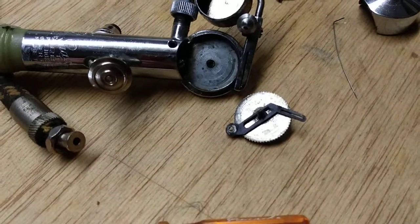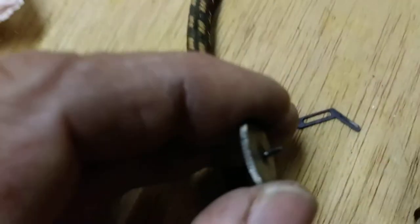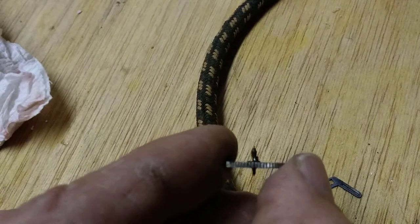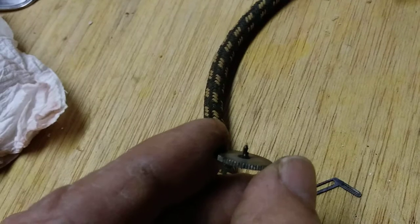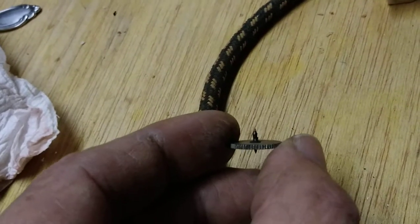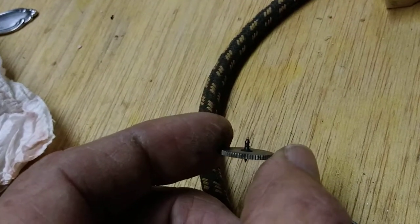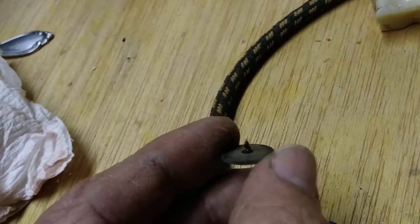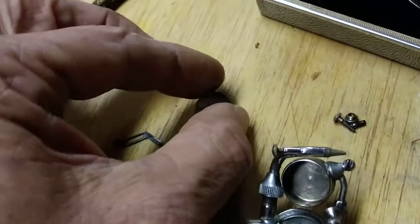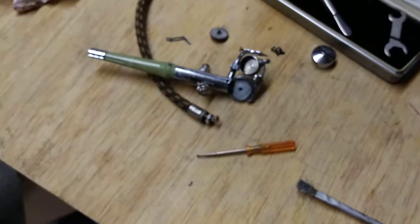So I'm going to clean this up, oil it, see if I can get it back together without destroying it. I lifted the needle arm off there. You can kind of see the little eccentric on the wheel there. The top side of the wheel — there it goes — you can see that's the cam action. That little nub there, when it turns, that little piece right there on the shaft is what moves it back and forth. That's where all the needle action takes place. It's pretty clean, got a little dried grease on the bottom. So I'm going to carburetor clean this and scrub it up, put a little tiny bit of sewing machine oil in there and see if we can get this thing spinning again.